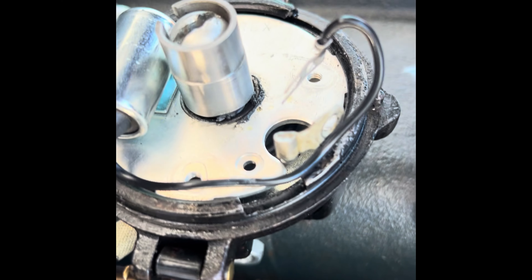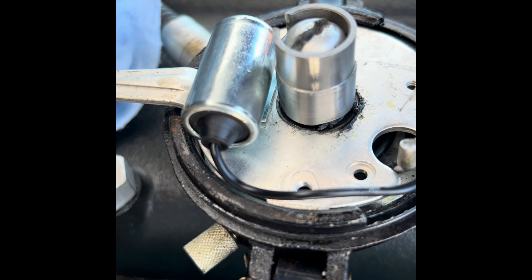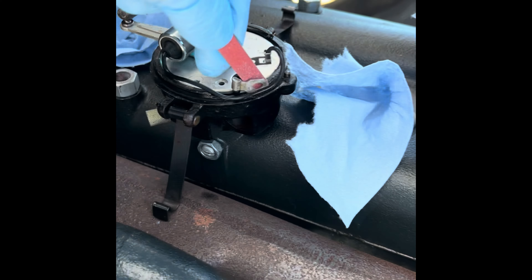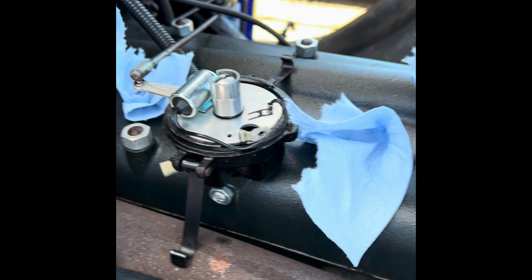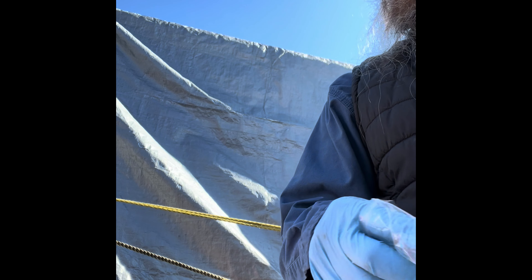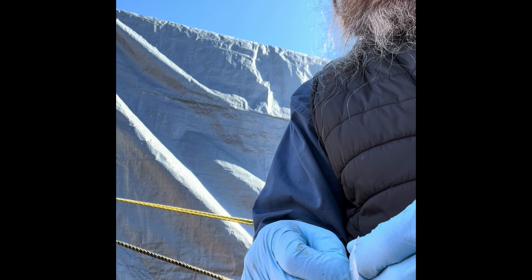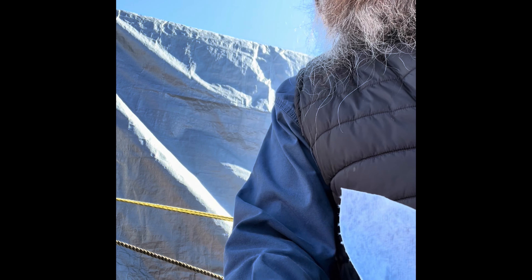I know a lot of people say you need to polish the points and get them really smooth — it cuts the drag down and wear on your points block rubbing thing. But I'm just going to wipe it off and lube it up with some more dielectric tune-up grease. Clean up the connections a little bit, make everything as good a connection as I can.